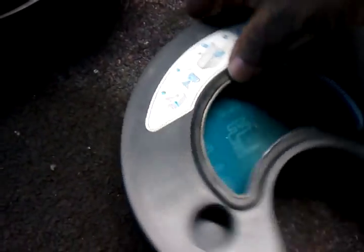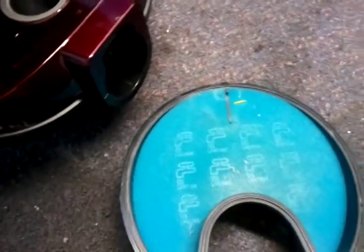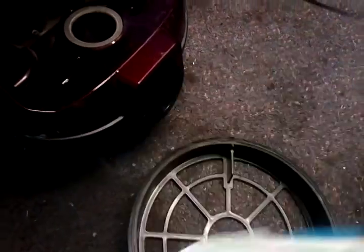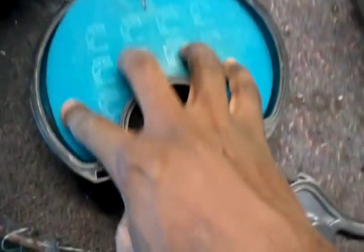So what you had to do was take that filter off and look at it. This is a washable filter. You look for this clip at the top, take it off, pull and unclip it, and then you expose that washable filter. Pull it out like that and give it a good wash. After the wash, make sure you dry it — it has to be really dry. Then you put it back in that way, making sure the little white part goes at the bottom. Then you clip those two notches in at the beginning and make sure they are in.